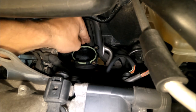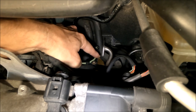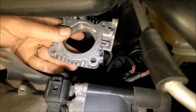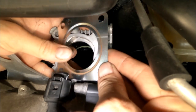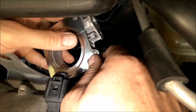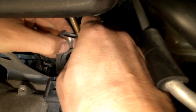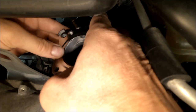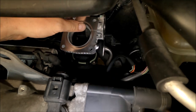Just a little bit more — and that's it. It will not move and will provide the needed seal. Now I will put this part on, but first I put the gasket to the throttle body. You can only put it one way — you press it in here and here. Also press this part firmly in. This is why this gasket is only usable once — it is nicely seated and will not move.